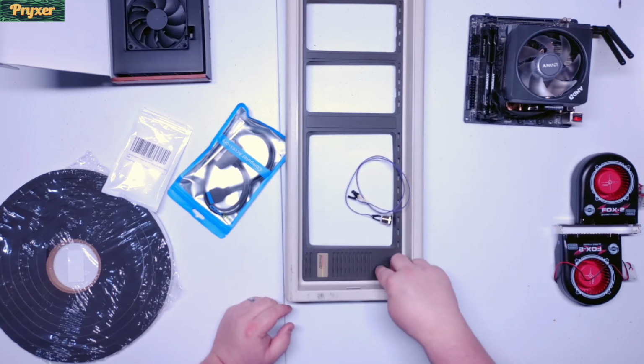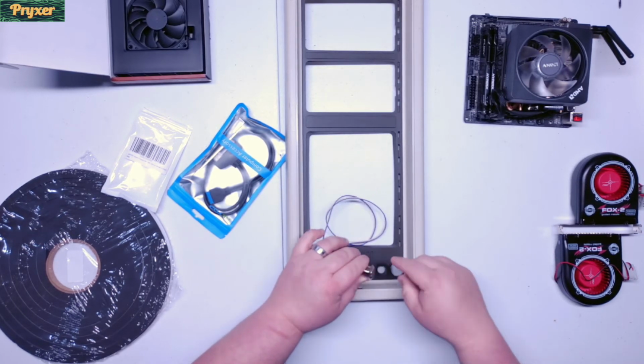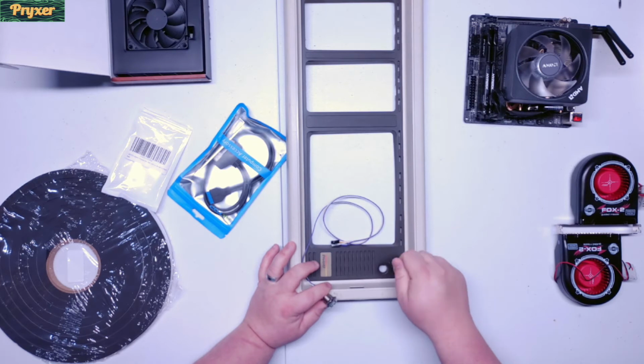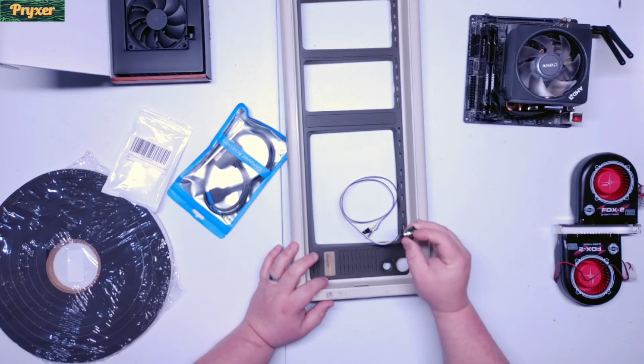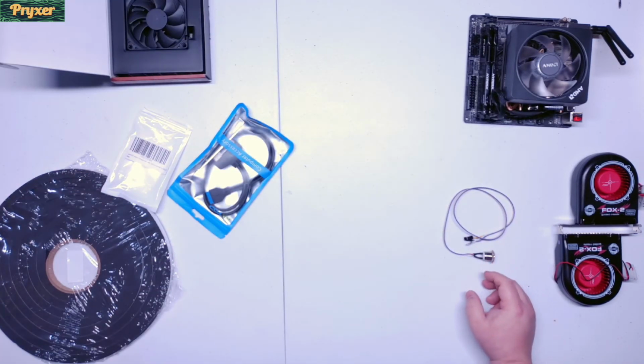I'll just have to drill that out just a little bit, because this is, like I said, a 16 millimeter, and this will go right in there, and then we can still use the existing tube with the USB-C cable. That's where we'll have our cable, so you can plug the motherboard in, so it'll be Type C through the old mouse cable hole. That'll be cool. That's pretty neat. Feels so good. That's a nice feeling button. All right, moving on.